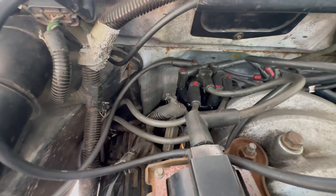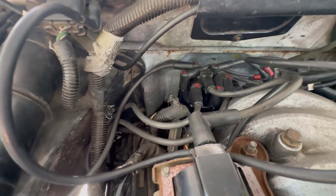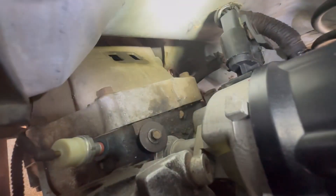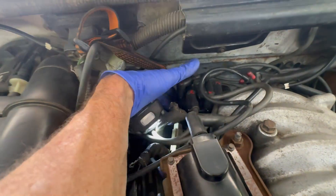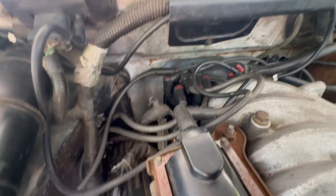At this point we pretty much knew we were going after the pickup coil, which is inside here. I've got another video that shows you a picture of the shaft when you take the whole thing out. There is a 10 millimeter bolt — you need to pull that bolt out, there's a washer attached to it. Once you do that, the entire shaft for the distributor will come out. I'll show you a video of what that looks like in the description. You pull the whole shaft out and then you have to replace the pickup coil.